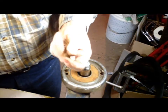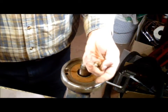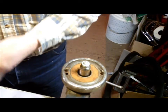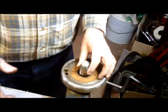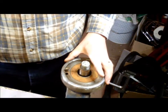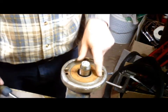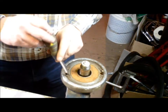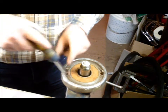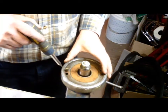These little buggers — we're going to throw them into Evapor-Rust and test it out. I'll make separate pictures of that so we can see how good Evapor-Rust works. If you're not modifying the variator and you're just digging through to get to the clutch, the next part is four screws. The holes those screws are in — when they're reefed tight, the factory stakes one corner to go into a little cutout on the screw holes. You'll see what I mean when you take it apart.